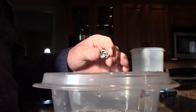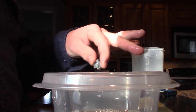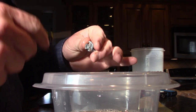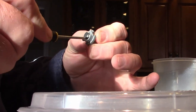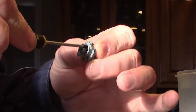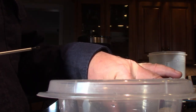I've had all these connectors and all the bulbs — because I'm going to reuse my bulbs — and my screws for ground soaking in this vinegar solution. I've cleaned them with a nylon brush and now I'm just going to take a little screwdriver and flex these tabs in to make sure we have good contacts. Then I'm going to put them in some soapy water to neutralize the acid.